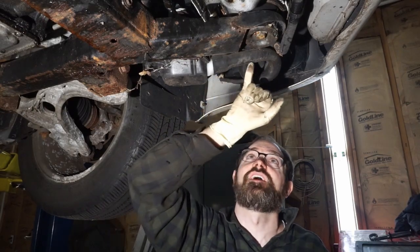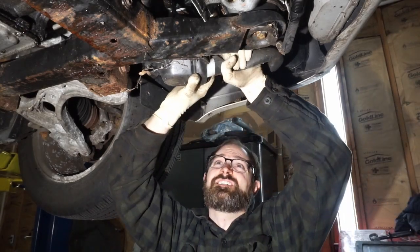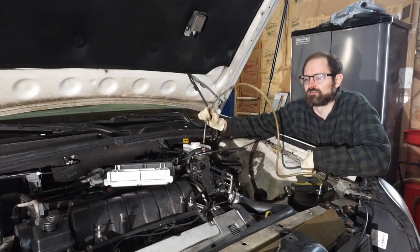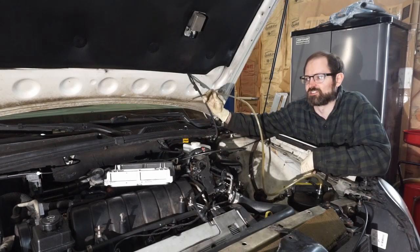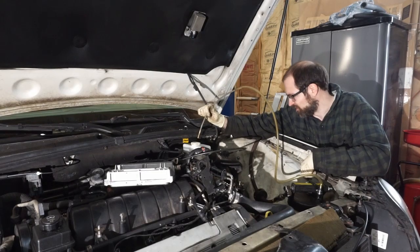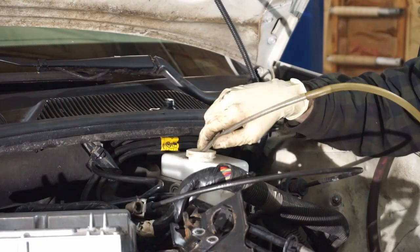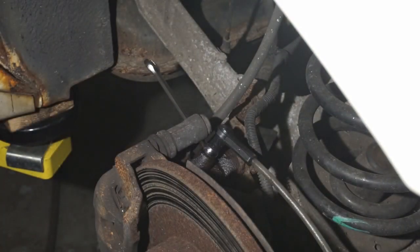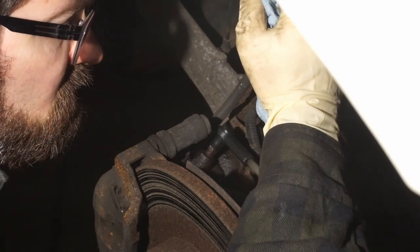There's a rubber line for the air pump here that runs up to the air injection system — just got to wriggle this off and let it hang. Now we're going to suck out the brake fluid on the master cylinder here. This is basically to stop a giant leak all over the floor when we disconnect the lines to the back. I'm going to try and siphon as much fluid out of the rear brake chamber as possible, draining the rear calipers using suction, then we'll disconnect the lines from underneath the car.